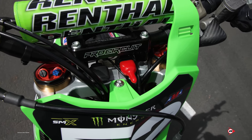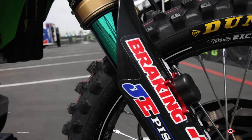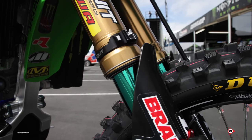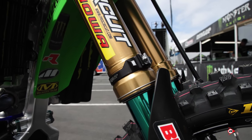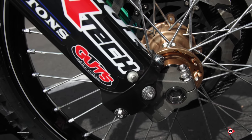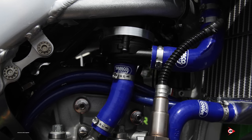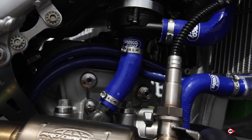We have our holeshot button designed for the race team. We can go to the top button and it's not breaking free as much, but with the Supercross gates we run it as deep as we possibly can without damaging the fork guard or anything else. Underneath we have a fork guard brace. For our radiator hoses, we run strictly Oetiker hose clamps — you can't unscrew them or anything else; they're one-time use. As we rebuild the bike, we cut them off and replace them new every time, so there are no clamps on the bike that can be unscrewed or taken off — there's no risk.